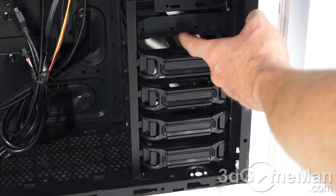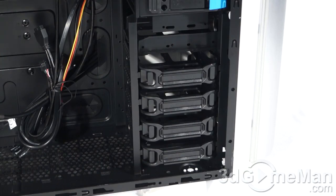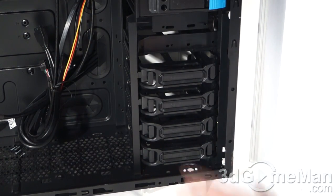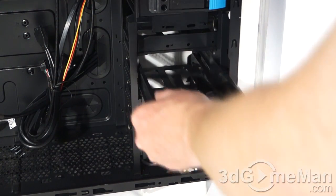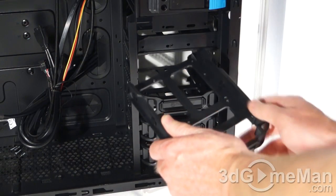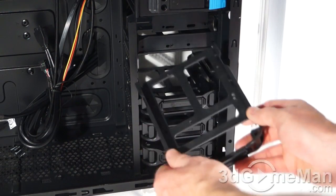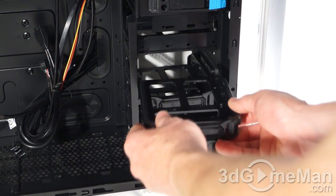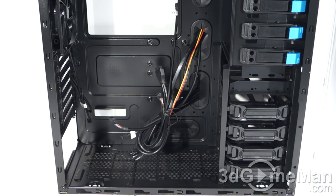You can install up to five 2.5 inch or five 3.5 inch drives — you can install the extra one just above the main four. Installing drives in these bottom four drive bays is really easy, especially for 3.5 inch drives. Simply pop them in, kind of bend it open like so, pop the 3.5 inch drive in, and slide it back into place. If you're installing a 2.5 inch drive, you will need to use the included screws.